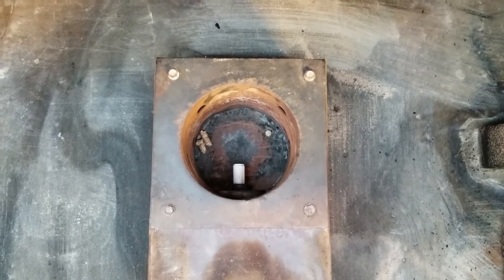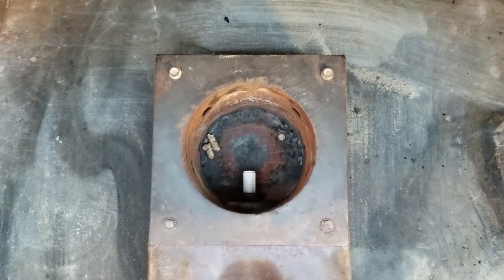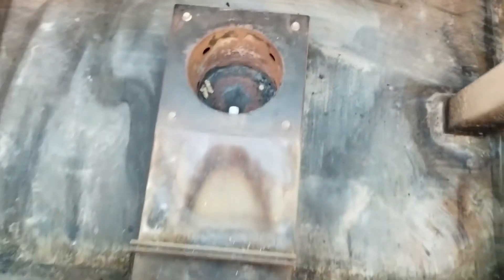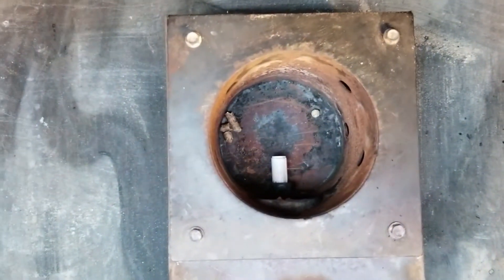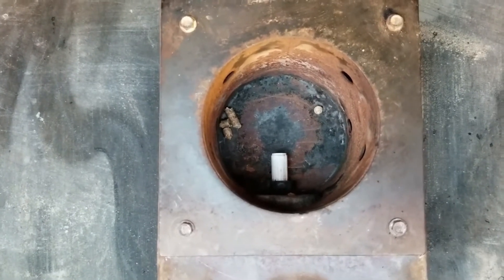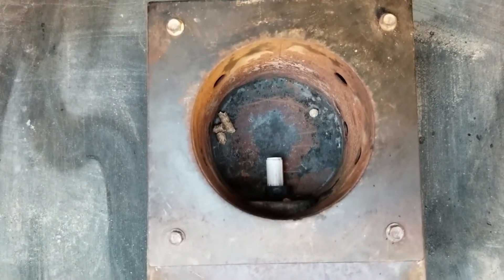The other one cracked and the wire burnt up so it had an open in it, which is good — that's a good failure mode. You don't want it shorting. So let's go ahead and try this again. I'll go ahead and hit start and let's see how this thing does. The last igniter had cracked, and that's what that popping was — the ceramic cracking. And then it just finally shorted out.